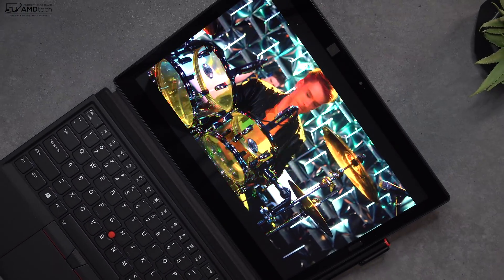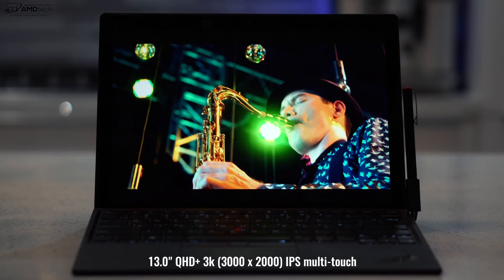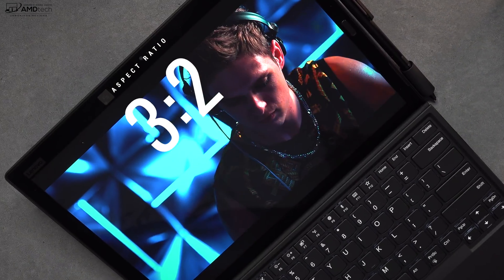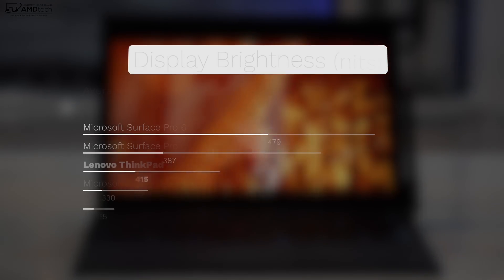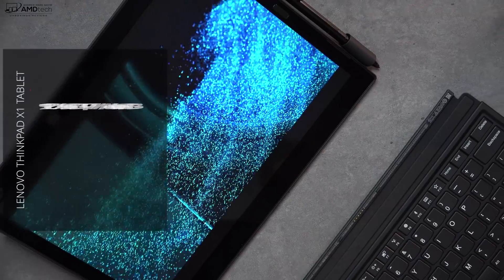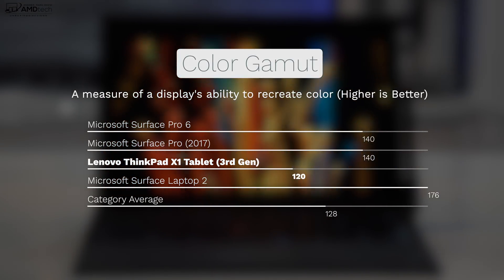To me, the star of the show is its gorgeous 13-inch IPS LCD display — absolutely gorgeous. It's a 3K display: 3000 by 2000 resolution, and it's a responsive multi-touch display. Lenovo did a fantastic job here. At 277 pixels per inch with a 3-by-2 aspect ratio — my favorite — it's a nice blend between productivity and consuming media like Netflix and YouTube. It's a very bright display at 415 nits, above the category average, great for both indoor and outdoor use. Colors are really vibrant, and it covers 120% sRGB — so if you're a creative professional, this is definitely a 2-in-1 to consider.